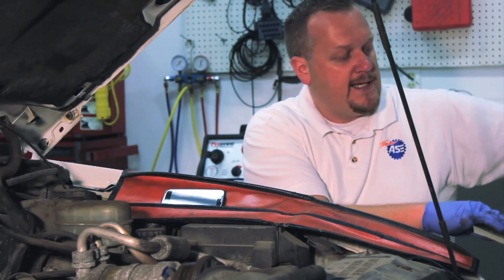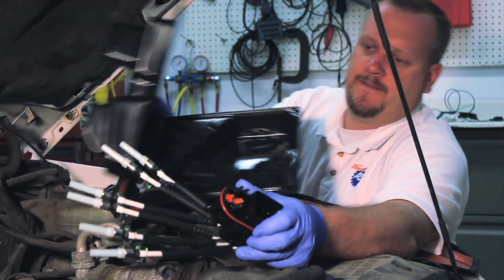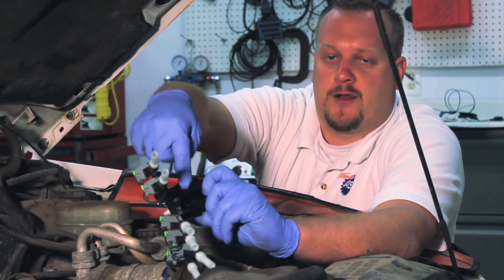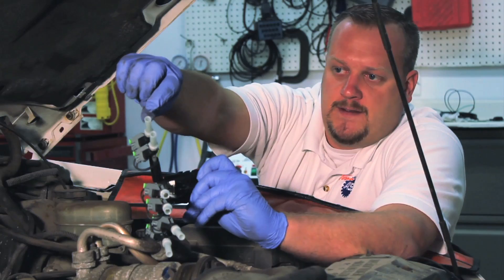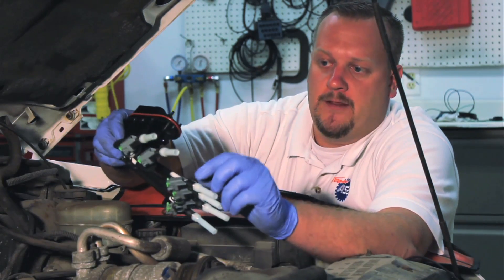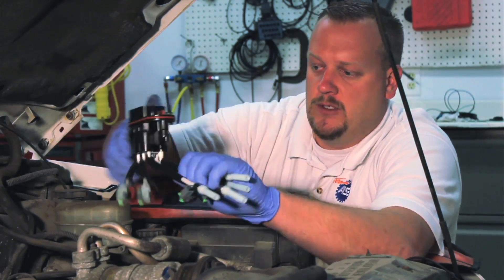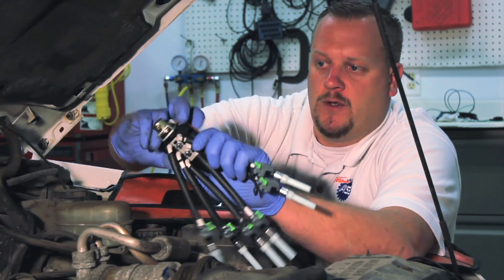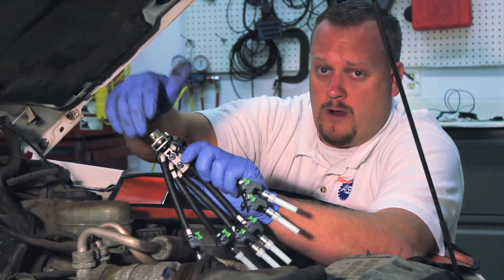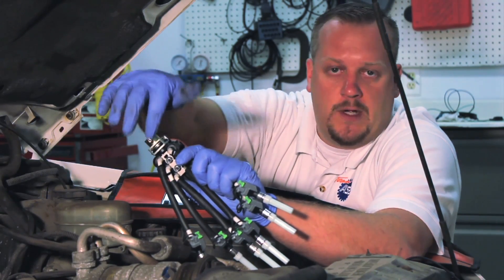Let's remove the unit out of the box. It certainly looks much different than the original unit — originally the injector was mounted up in the plastic body and we had spring-loaded poppet valves down where it inserts into the intake. Due to some design changes, the actual injector itself is now mounted down at the bottom, which is why we see some wires and different connectors. This is a direct replacement unit for the previous design. You'll also notice there's a fuel pressure regulator on the back side. There's no hose connection needed because rather than referencing atmospheric pressure, it references intake manifold vacuum — it's already mounted inside the engine.